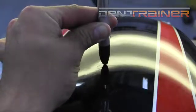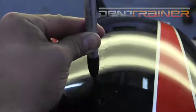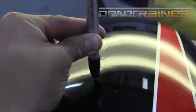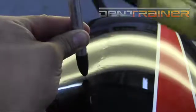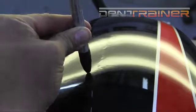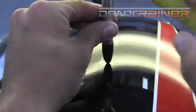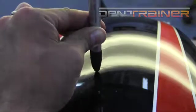It's a lot like glue pulling. You're rarely ever going to glue pull something flush. You're always trying to pull it high. Because once you pull it high, you can use the control that you have with that hammer and knockdown and lay it down flush. And that's exactly what we're doing here. Little by little.